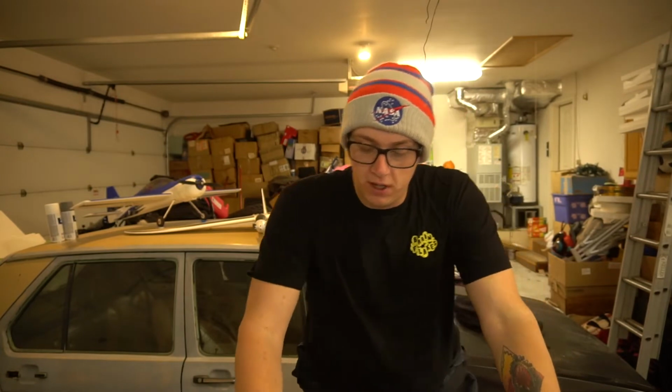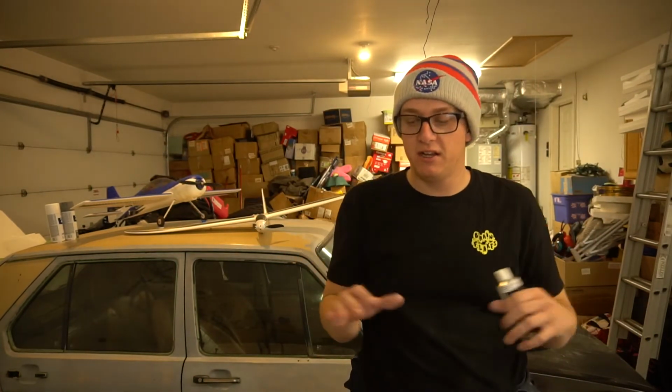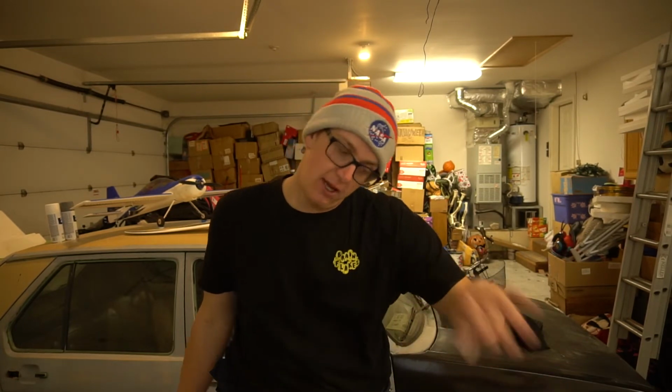Now, those of you familiar with body filler in the automotive world are going to warn me not to use that much because it sands pretty difficult. This is spot putty. It sands about 100 times easier than regular Bondo body filler. And then those familiar with spot putty are going to probably warn me that it cracks very easily, but don't worry, about 95% of it's going to get sanded away. We're just creating a blank, a coverall basically, to take care of any issues we have preemptively. We're going to sand it all down so you basically can't see any anymore, and it's only going to be there filling the spots that needed filled, and then we spray primer, and then we fill again.